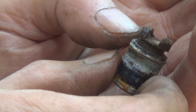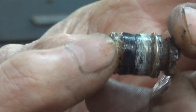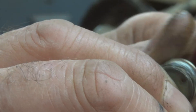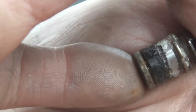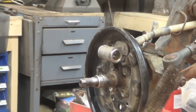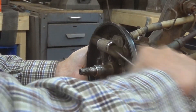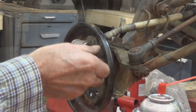These pistons have a ring around the top that keeps them from going back in too far, and that's actually where most of the problem is — you can see it's rusted right around that ring. It's a little gummy down at the bottom where the rubber is, but I think we're going to be able to reuse it. We'll clean it up and run a wire brush through the inside. I don't have a small enough cylinder hone, so I use a wire brush to go back and forth inside there.